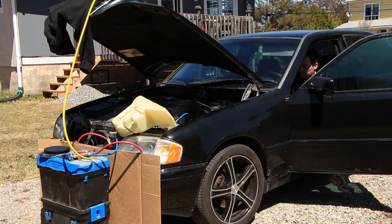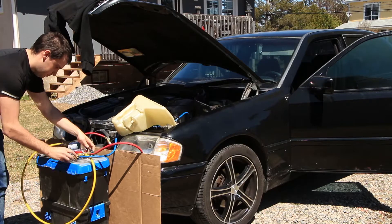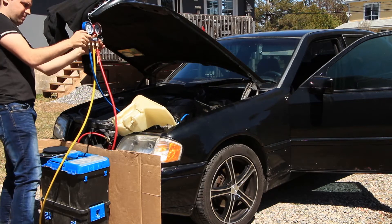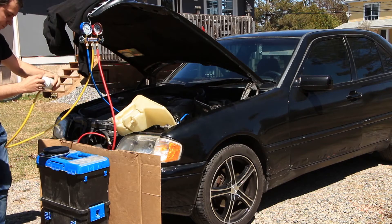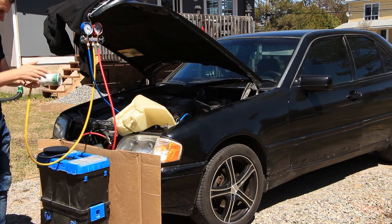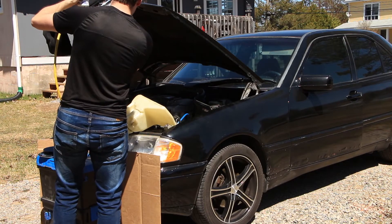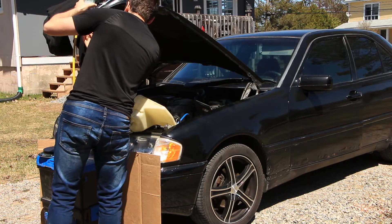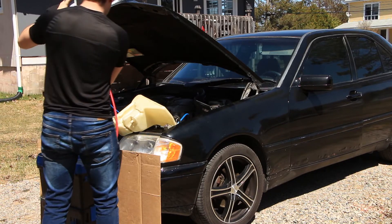I spun the compressor by hand a few revolutions to make sure there is no liquid in it. Now I'm going to start the car and crank the AC to the max — maximum fan, low temperature, and recirculate on. With the compressor running I just shake the can upside down until I can feel it's empty, then close both the manifold valve and the can valve, unscrew the old can and thread on a new one. For the second can, the key is to do it slowly, because in a system with an expansion valve there is no accumulator and the low side service port is right at the compressor inlet. There is a small risk of liquid being sucked into the compressor, but if you fill the refrigerant in slowly in small bursts you won't have a problem.